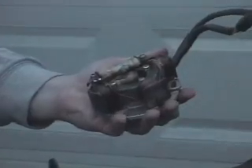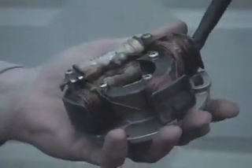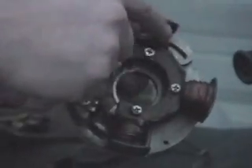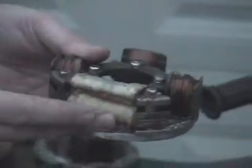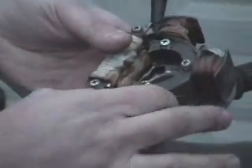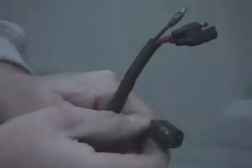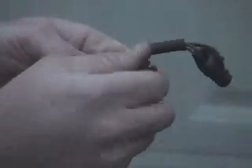We'll bounce through just a couple more. This is like a ZR 440, 550, 650, 700s, early 90s. You've got the three big lighting coils here, and then we've got our two ignition coils — our low speed on the bottom and our high speed on top. So instead of having several posts wound, we've got three large posts. On this unit we've got two non-yellow wires — black and brown — and we've got two yellows coming out of here.